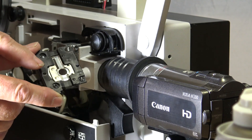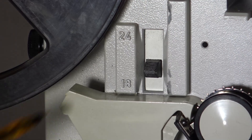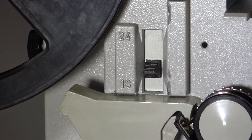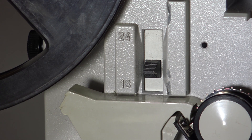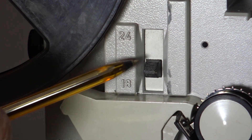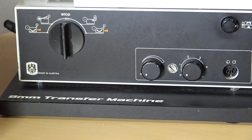You also see a portion of the sprocket hole, which can be cropped out in the edit. They adjust the projection speed to get rid of any strobing on your video camera, but with my camera there was still a slight strobe. So I removed the silicone paste that they'd put on there to seal it, and I just had to adjust it down just a tiny bit.